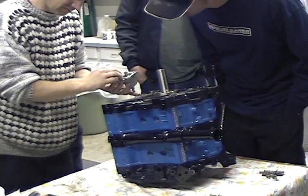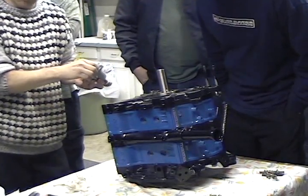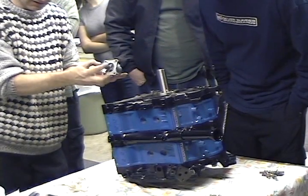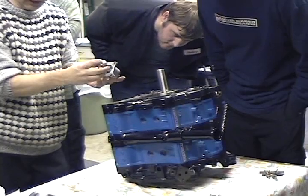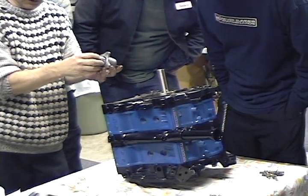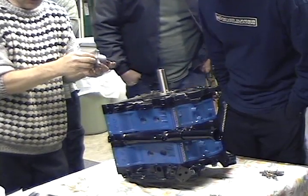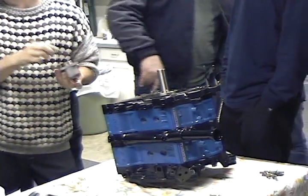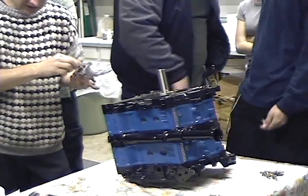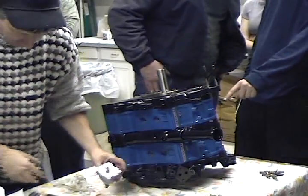What the hell is that? John, you prime the oil pump? I don't know what that is, man. All these oil pumps aren't built to last. You take this out and you take a look at it — some are shorter than others. The ones with the taller ones are the ones you want. For instance, 86 and up, you get a turbo oil pump. They've got more thickness to the gear, so you get more volume.